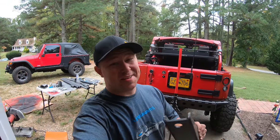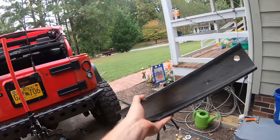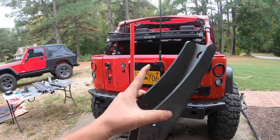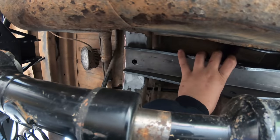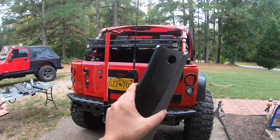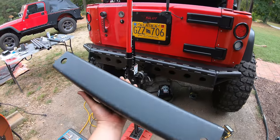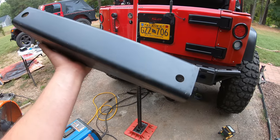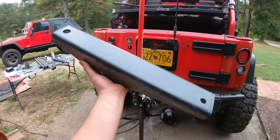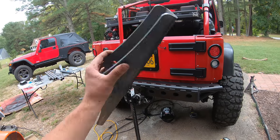That bracket is done — not much fun welding that up under there. Next is the upper link mount for the rear, going between the two cross members on the frame. It aligns with the two holes in the cross members and we weld it in place. For the sake of the video I went ahead and ground those cross members down to bare metal and painted the back side with Steel-It — don't paint the areas we're going to weld. I painted the top side of the bracket now because once it's welded in place it'll be really hard to reach.